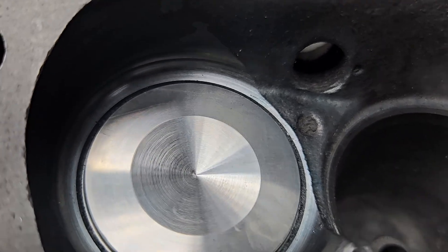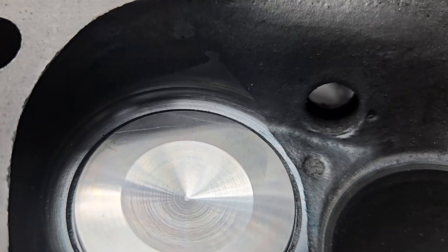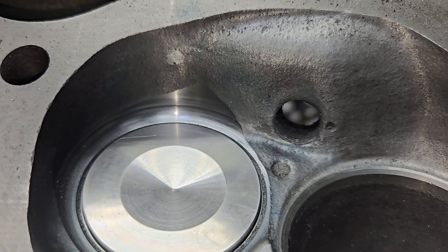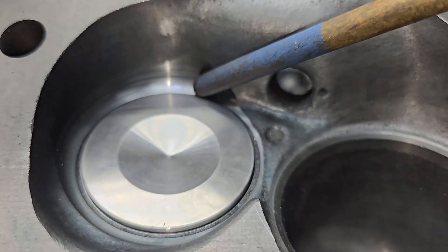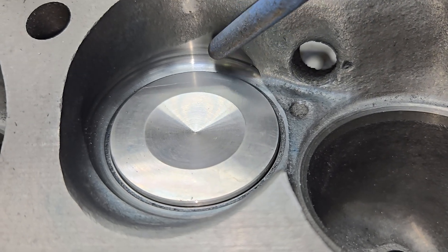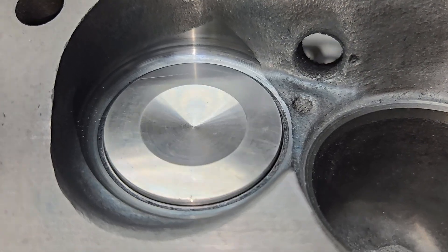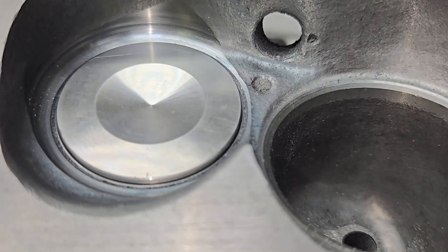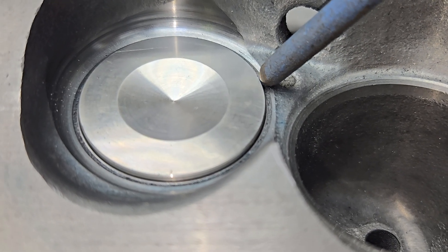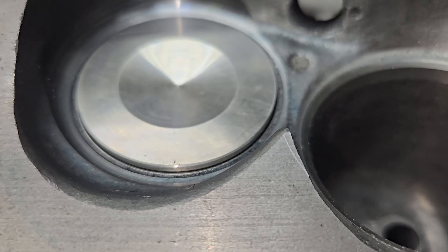Let me add some light to this — okay, you can see where it just touches the chamber. It just touches the chamber, and you have to have a nice top cut. The top cut on this was awful — it was a huge section where it went down about 50 thousandths. Tons of sharp edges around this; we have to eliminate all that.